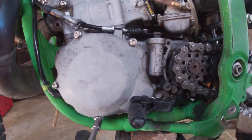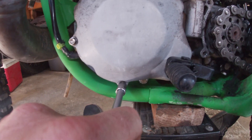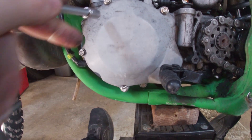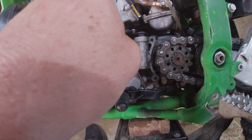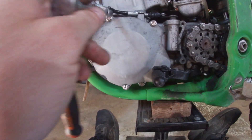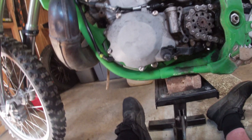After you've pulled your cover off, done your inspection, and made any adjustments you wanted to make, throw your bolts back in and put the cover on — make sure the gasket's good to go. Just snug them up, don't overtighten them. Ready to go.